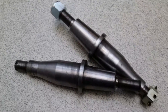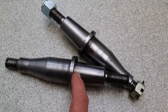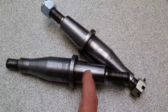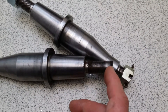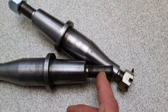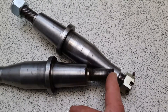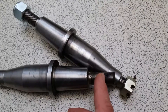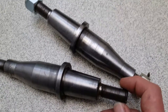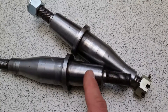The approach I'm using now, instead of making these from scratch, is to take an existing XJ-S stub axle — they're fairly cheap, about £40 — and just machine a narrower, smaller taper on the back end. Cut the existing stud or spigot that's on the back of the XJ-S stub axle, because it only goes up to about here and you need that extra length for the Mk2. Then put in a new stud: I use 1 diameter depth of thread, so about 16mm — that's 5/8 UNF — so go about 16mm in with the thread, possibly drill a little bit further for tapping out.